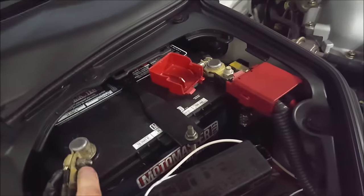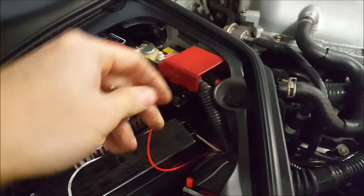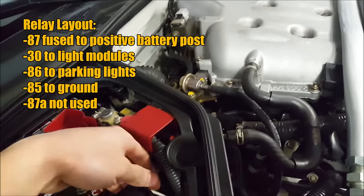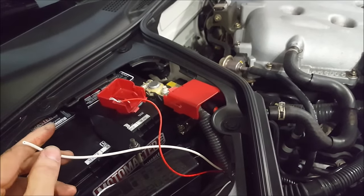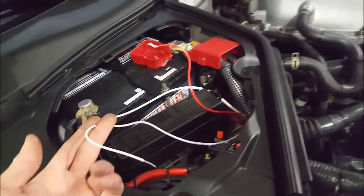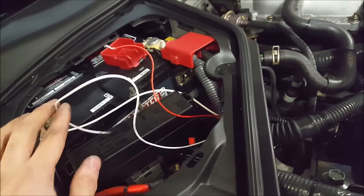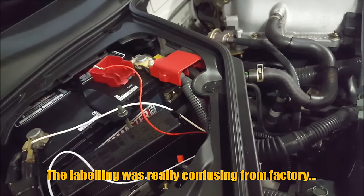I've attached the ground and added a washer, putting it right onto the terminal off this nut. Over here is the trigger wire for power — I'm going to feed this onto pin 30 on the relay, and 87 is going to go straight to the battery. I've run a new white line that hooks up to 86, and 85 is going to go to ground. This will trigger whenever the lights turn on, turning on the relay and thus the lights. I didn't hook up the white wire already in the harness because there's a cap or diode on the ground line for the DRL circuit, so I ran my own line for my relay trigger.